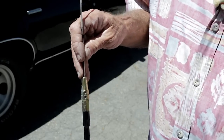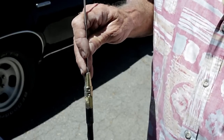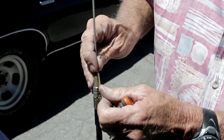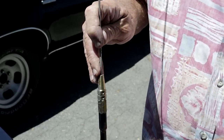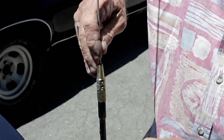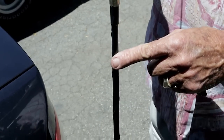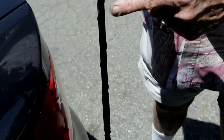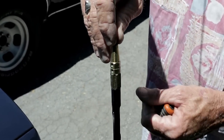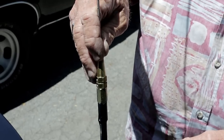Once you have found the 50-ohm impedance match — either by a transceiver's built-in automatic antenna tuner or with impedance matching devices — it's time to tune to a specific operating frequency. If you pull the whip out by loosening the set screws, you'll go lower in frequency, about one inch for every 100 kilohertz, no matter what band you're on. If you push the whip in, you go higher in frequency, but the whip will bottom out where the windings go through the fiberglass shaft. Never force the whip down past that point, or you'll break the inside winding wires.